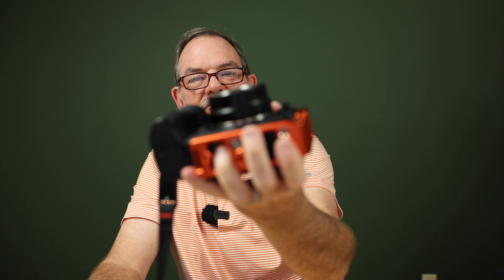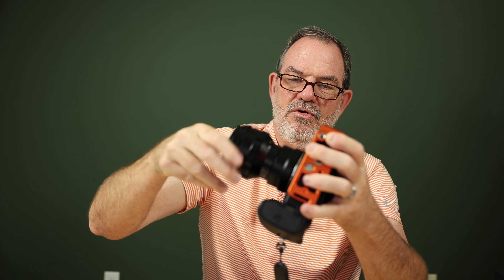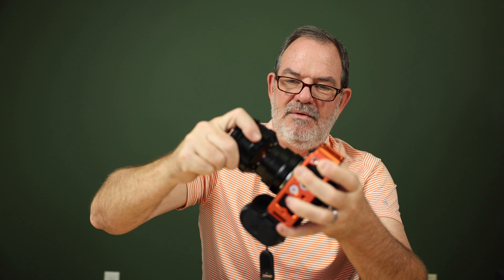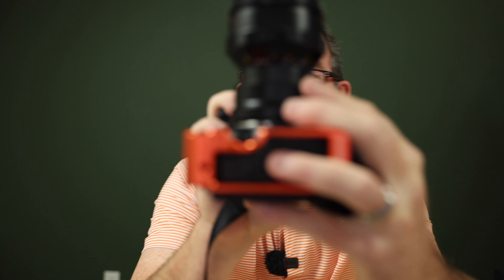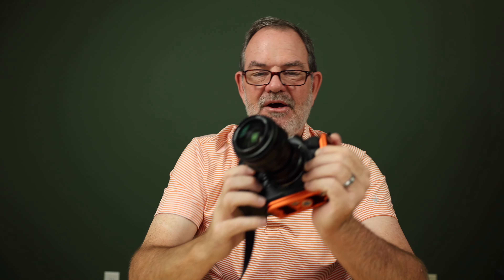Today Heather and I are going to take a trip from Chattanooga up to Knoxville to visit my daughter and her husband. I'm putting this lens on my Nikon Z8 with an M42 to Z adapter. The lens just screws on, and there are three tiny screw locations around the lens barrel. I bought a super tiny T5 Torx screwdriver so I could loosen those three screws, get the lens indexed perfectly, and then tighten them down.